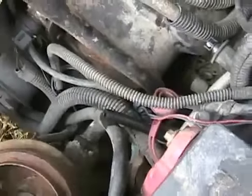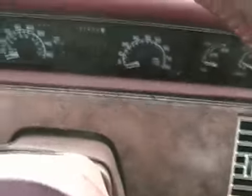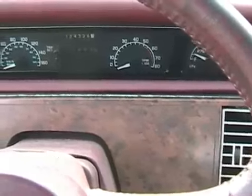Coil's plugged in. I don't do it on this car — I drove it there last year. I don't hear the fuel pump. Has anybody been messing in here? We just did a quick check of the fuses and they're all good. Fuel pump's coming on now.